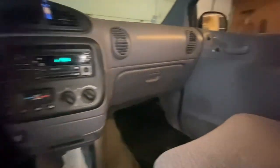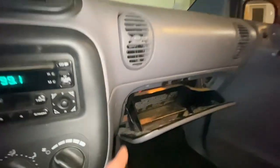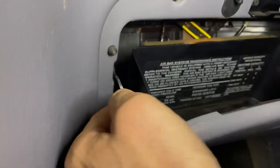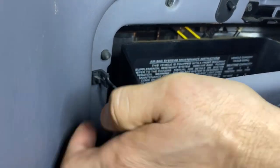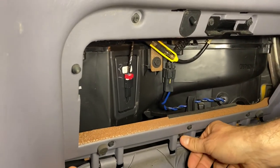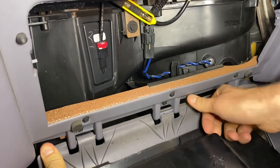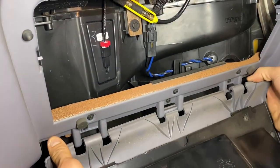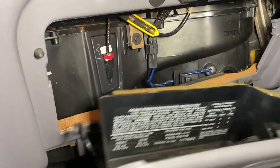The blower motor is located down here. Very first thing we're going to do: open our glove box and remove these straps right here - there's one here and another one over there. Let's pop these guys off. There's one, there's two. And this folds down. There's a little snap right here - if we push on this, it should just pop out on the backside. Now we remove the glove box.